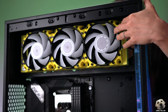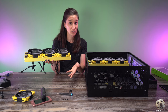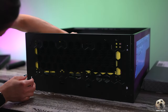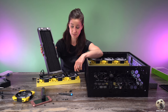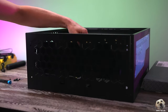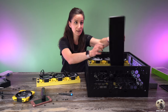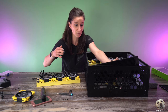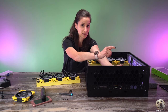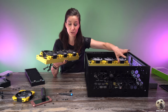Tighten these up — this is our bottom and here's our top. Let's get them in the case. I think I'm going to have to call this PC 'Sunshine' because that's what it reminds me of — it's making me very happy. When I was trying to install the bottom radiator, I ran into an issue because the holes on the back of the radiator to mount to the case weren't lining up. I grabbed another radiator — a newer design by EK, still a slim SE 360 — but pretty much the same story. The only way to get it to somewhat work is if the fill ports are closer to the distro plate.